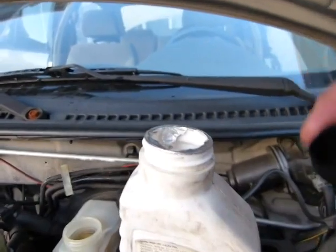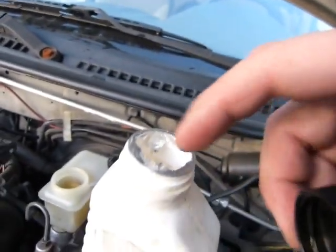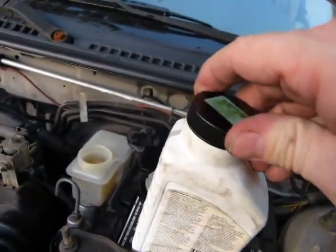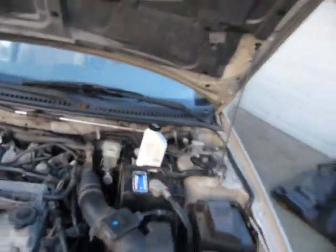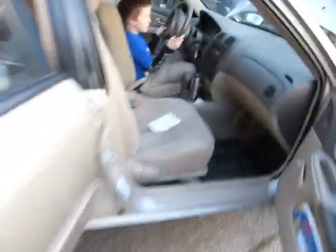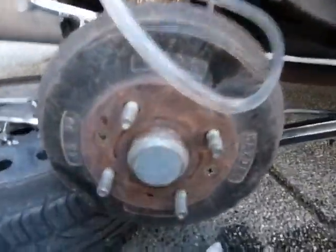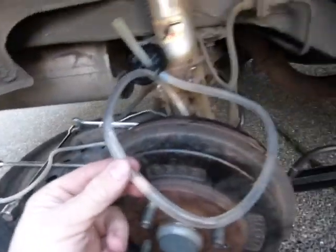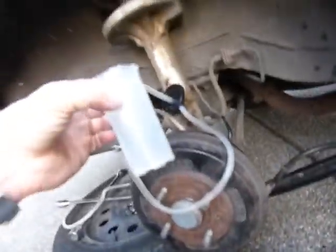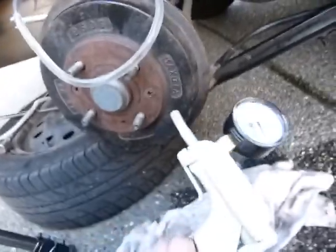Get your brake fluid container ready and open it carefully so you don't get any plastic or aluminum debris into the brake fluid — that's just going to make your life extra miserable. You need a person who operates the brake pedal. And basically all you need is a PVC hose — this one has the lid attached to it and a container attaches to it. I also have a vacuum hand pump, but that's not necessary.